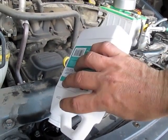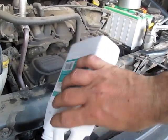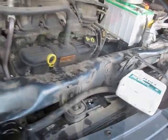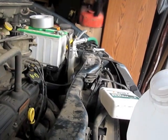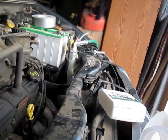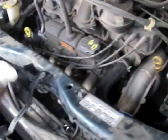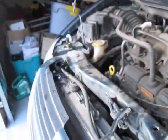Make sure you have your drain at the bottom of your radiator put back in place so it isn't leaking out. Add your Super Flush, and then fill this with distilled water. When you're done topping off the water, I will start my car and watch to see if I have to add water to the radiator.